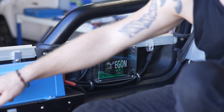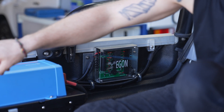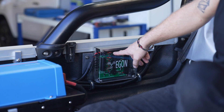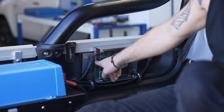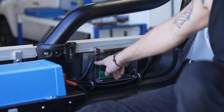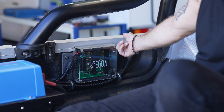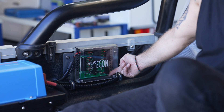You can use the big 80-amp connection on the relay hub to run a cable to a constant power output. In this case, we use the Klarman power station and connect it to the front panel with the Anderson plug. As soon as you plug it in, you supply power to the whole board. As soon as you put fuse number one in, you give constant power output to the input/output terminal strip, so you can run a charge port in the front of the vehicle on circuit number one.